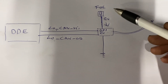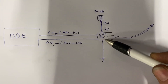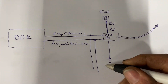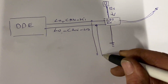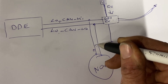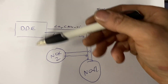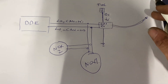You've got the DPS EV - diesel particulate sensor evaluation electronics - engine ECU, DDE, four wires: local CAN high, local CAN low, 12 volt, and a ground. All you need to do is get your power probe, check have I got a ground with it plugged in, have I got 12 volts - yes. On low CAN you'll also have branches going into things like NOx sensors as well, same system. This is literally just a CAN bus but only for the components in the exhaust system - you might have NOx one and NOx two. It's just a local bus just for these components.